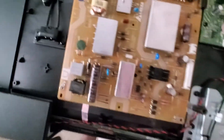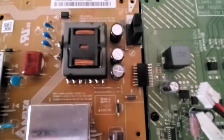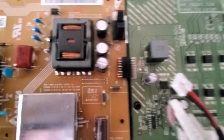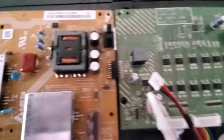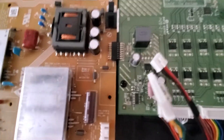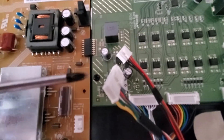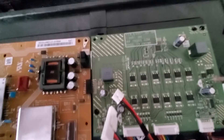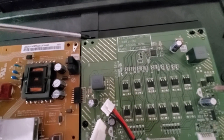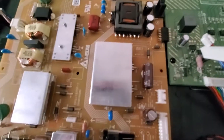Now that you have all the connectors off, the last thing you need to do is disconnect this little connection right here between the power supply board and what I believe is the backlight board. The easiest way is to pull it left to slide these pins out. If you unscrew the screw right here and pull out this little tab up here, you can pull the board up a little bit, making it easier to slide out.